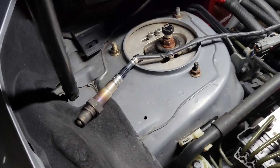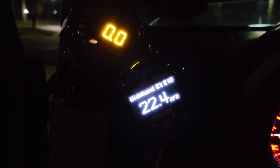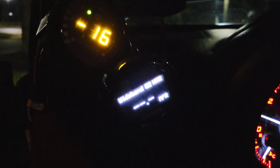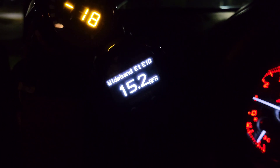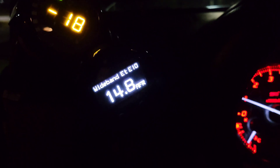Alright, it's plugged back in, the O2 sensor is just chilling out, and we're going to turn the power on. Let this thing sit for 60 seconds and it'll show calibrating. It's going to heat up about 30 seconds. I was waiting 30 seconds and it calibrated really quickly — I hope I caught that. Now I'm going to put it back into the exhaust. Just plugged back in, hopefully everything is all squared away. It's going to take a little bit to heat up and then it's going to read within 30 seconds. There she goes — she's looking a lot better. Yeah, it was crazy because she idles fine. Alright, perfect — and that's how you calibrate and install an O2 sensor with the Innovate wideband gauge.